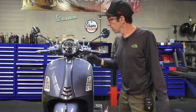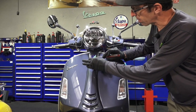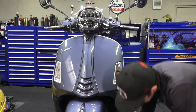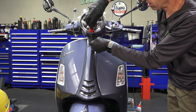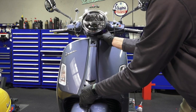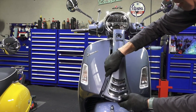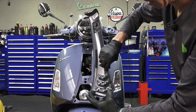First, we'll carefully pry off the badge with a very small flat-bladed screwdriver going from the left side and just carefully pull away. Don't twist the screwdriver because that's how you can damage the plastic. That reveals a single fastener that holds this front cover on. So use the T25 Torx driver to remove the fastener, and just pull the front cover away from the bodywork. It takes a little bit of force to pull these off for the first time, as it's retained by these pair of body fastener clips right here.